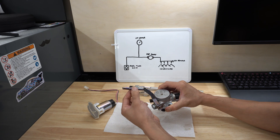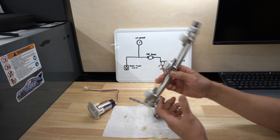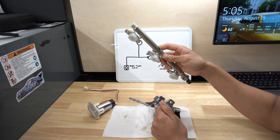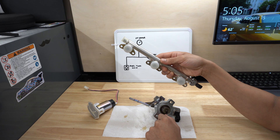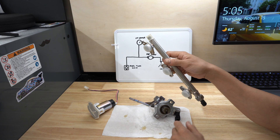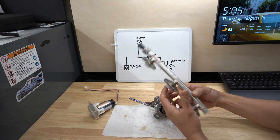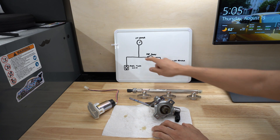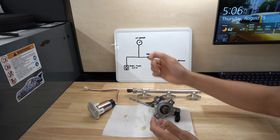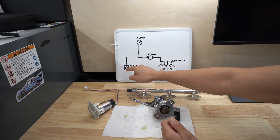Input from the low pressure side connects here; output to the fuel rail gets connected via metal pipe to the fuel rail. This is the fuel rail and your fuel injectors — this example was pulled from a J35 so there are only three injection ports, but the vehicle we worked on is a four-cylinder turbo so just imagine one extra injector port. At the end of the rail we have our fuel rail pressure sensor, which monitors and reports the rail pressure to the PCM. Target parameter for low pressure output is about 70 psi — as soon as you prime the engine and start cranking it reaches that immediately, which is how I determined the low pressure pump was okay.